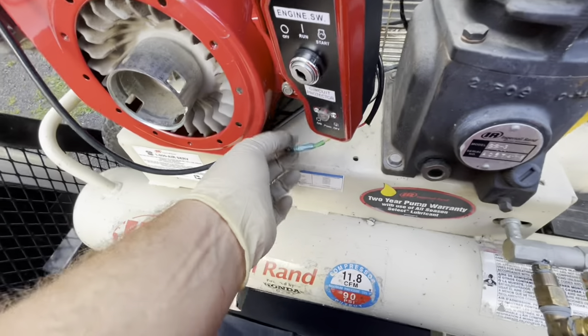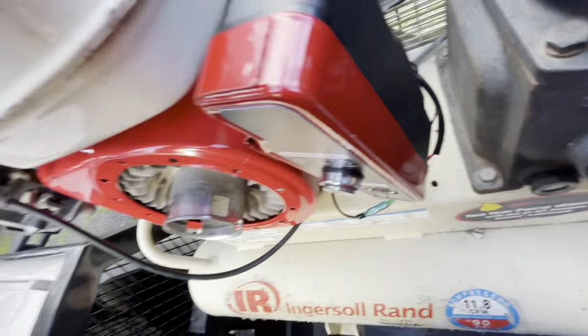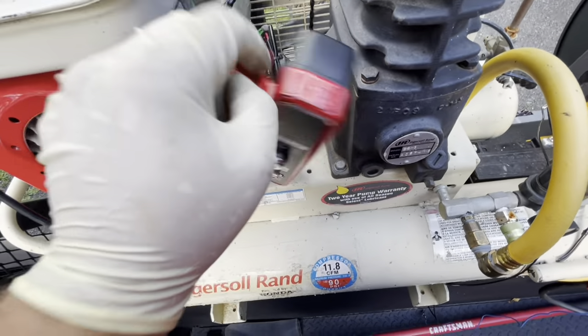So that's the yellow and green wire — goes to black, comes back up, goes back to yellow and green. The ground's there — that's the ground. So now I just need to make a power wire. Go to the back of the starter — that's going to go to the other end of the battery. Tighten the back of the starter up. I have this loose because I might need to get back there.